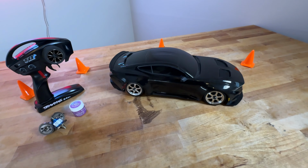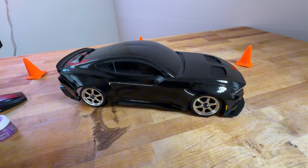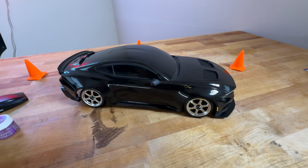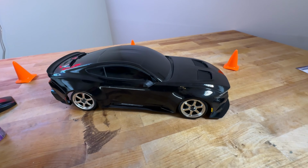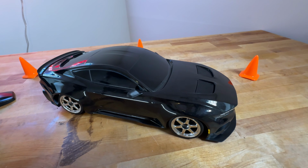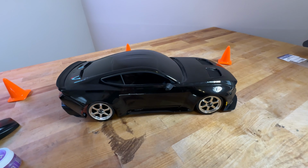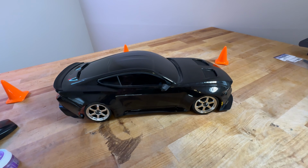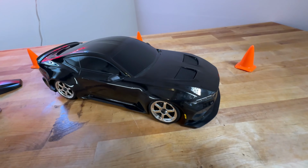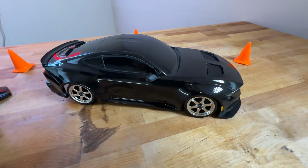All right, guys, one last thing. On this car, in the stage 2 setup, the best pinion for outdoor driving is going to be a 26-tooth pinion. That is going to give you the most excitement and take away that boring 13-tooth pinion, which is extremely slow for outdoors, and I don't like it at all. For indoors, 13 is fine. I go with 19 on the indoors. I want to go with the 26-tooth pinion for outdoor driving, especially when you're using the Tamiya Type D wheel, which is the hard rubber. A lot of fun to drive. You do high-speed drifts, high-speed passes. You could drive it like a regular RC car. It's a lot of fun, and that is my pick for outdoors.